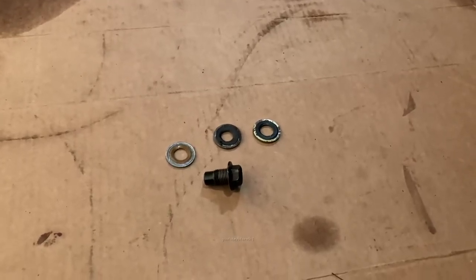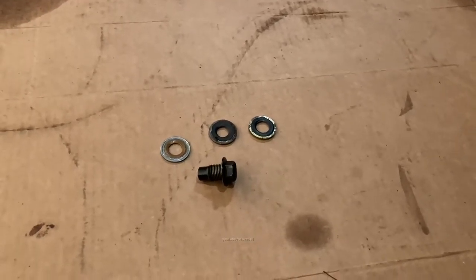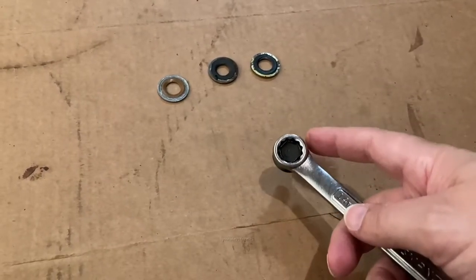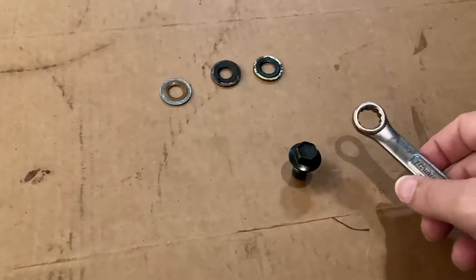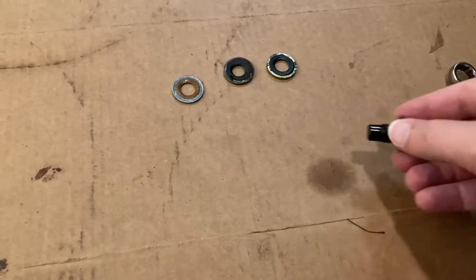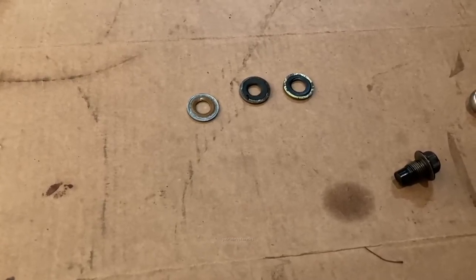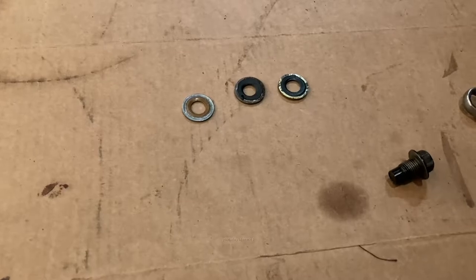Okay, another mundane topic, drain plugs. If you have a stock drain plug on your car, it's gonna be 14 millimeters. At least all the cars that I've had from the factory, which are a few, 9C1 cars and sedans and the station wagon and my Impala SS all had this 14 millimeter plug on it, non-magnetic. A common upgrade is to replace that plug with a magnetic drain plug. There are several sizes and options available, but I don't need to go into that. Just go to your local parts store and ask for a magnetic drain plug that has the same threads.